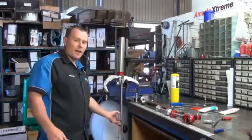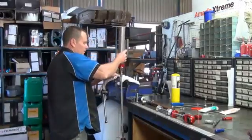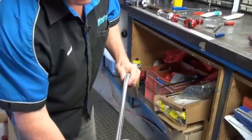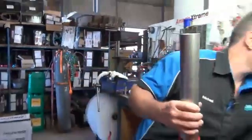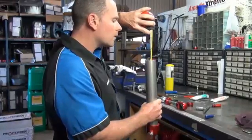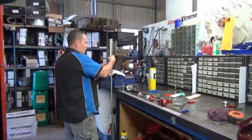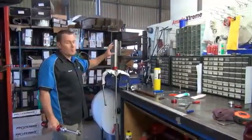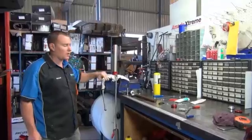Now what we're going to do is hang that down. If there's any air in that oil line, that air is going to come up and out to the top. The amount of oil you want in there is about that level — somewhere around 30 millimetres from the very top is the starting point; that'll be pretty close to where you want to be. Now there are no bubbles in there, because if you pour oil in you might get a heap of bubbles — you want to let those bubbles settle to the top before you go further.